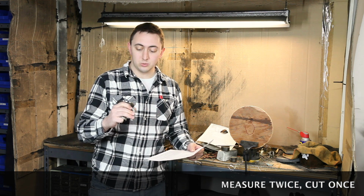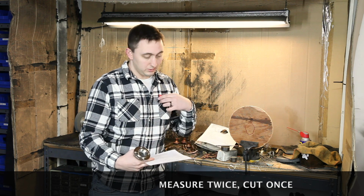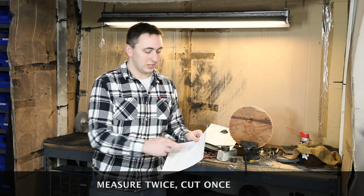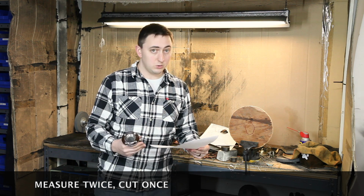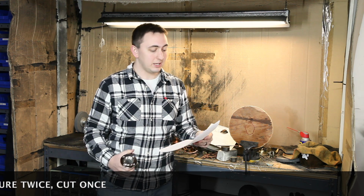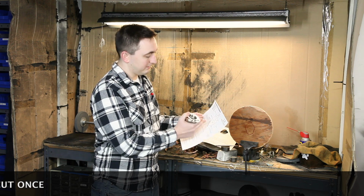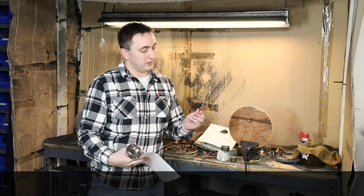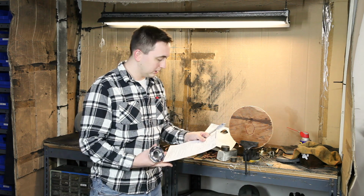So, to properly install this, there's a list of materials required. There is a marker that you can trace out. You'll probably also need an X-Acto knife or something to cut this out. You'll need a drill, and then 3 hole saws or drill bits. We don't really recommend drill bits, because usually you can't get a drill bit that's 1.5 or 2 inches, but we have a 3/4 inch spade drill bit that we're going to be using for the 3/4 inch hole.